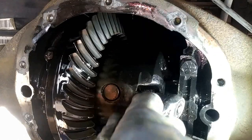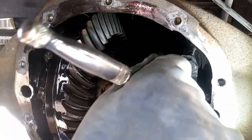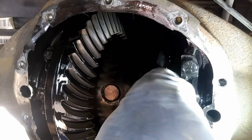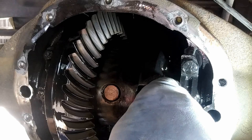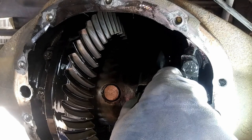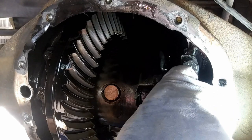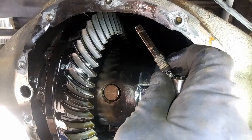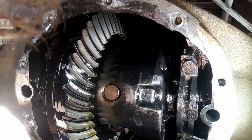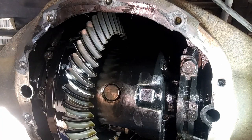What I'm doing is spinning the wheel as I was trying to get the bolt to where I want it, and then I locked it in place with my hand - or you can have someone else hold it in place. I have the car in neutral just so this can help speed up the process. Once we take off this bolt, that pin should drop, and when that pin drops, everything will be all said and done. Make sure you inspect it for any metal debris - that's what we're looking for, metal chunks. I don't see any shavings. This gear is going to be your most expensive piece.